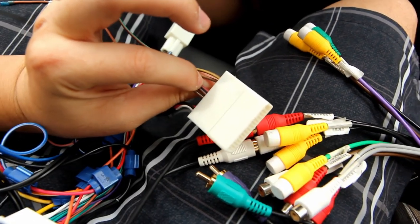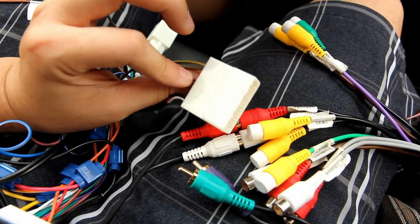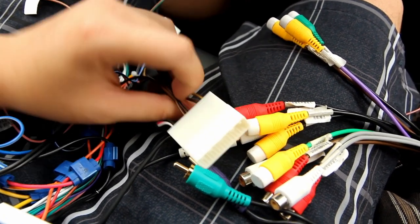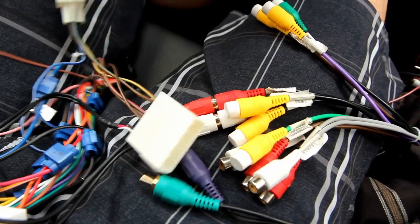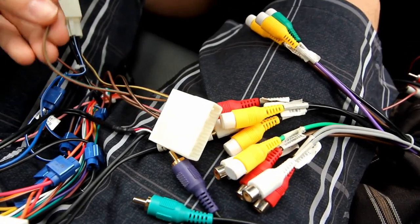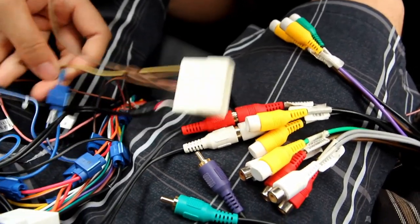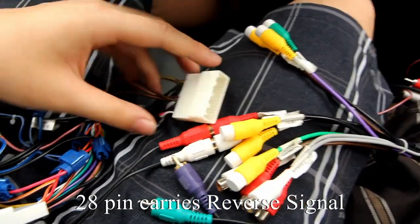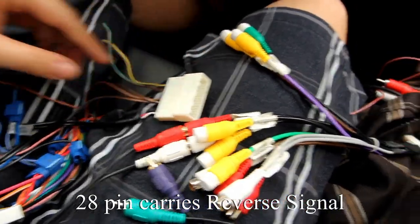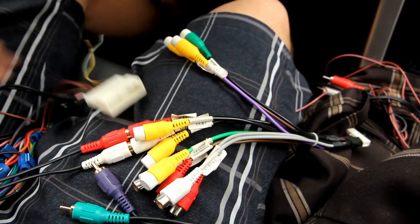The 28-pin also has your three steering wheel control wires — the one I'm holding right here. These three wires control positive, negative, and the ground itself for the steering wheel controls. I actually have two more pins but I'm not using them — I believe one is vehicle speed and the other I don't remember, but you don't use those two with the harness kit from AE64.